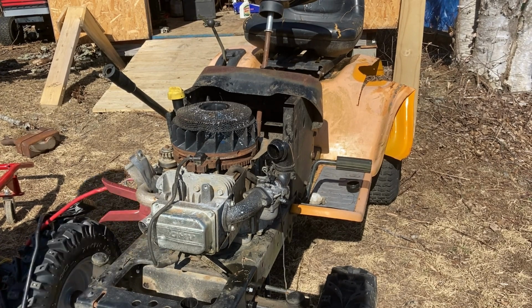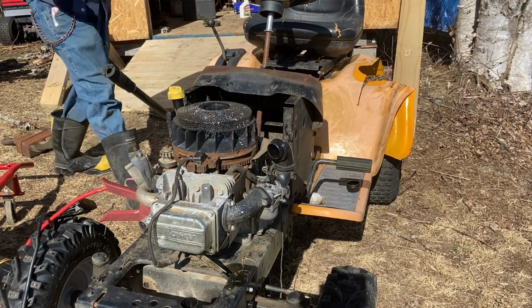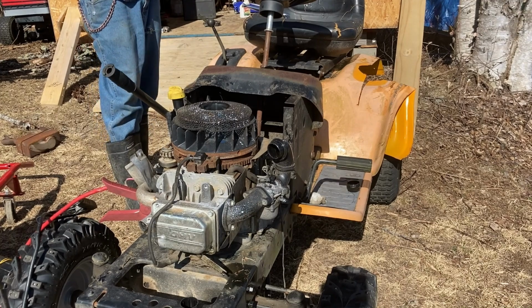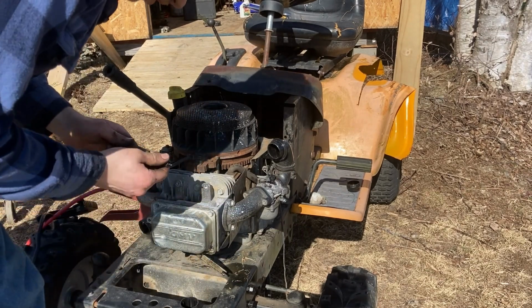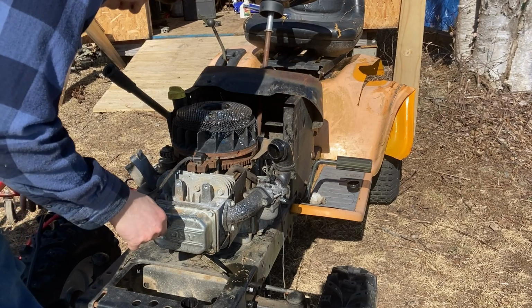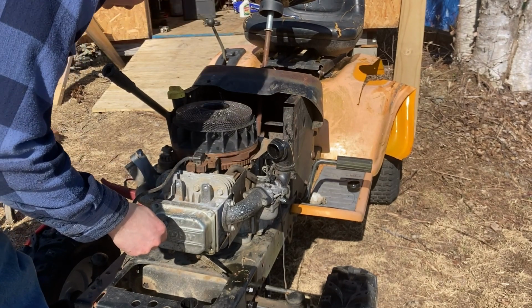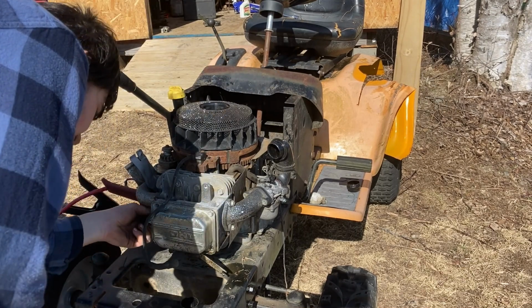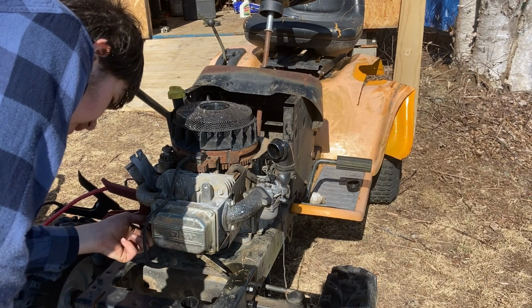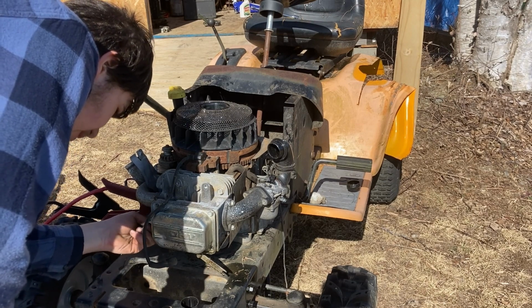Well, just to save time, I'll just rip the spark plug out of this other engine, as long as it was the right socket type. There. I managed to get a little bit of a gap back. I'm just going to ground this out and see what the spark itself looks like. Alright, let's try it. Doesn't show very good spark, but I am seeing spark. I might have too much of a gap. That's why.